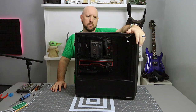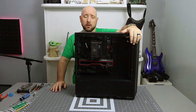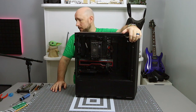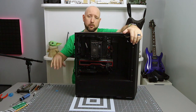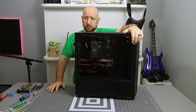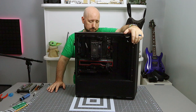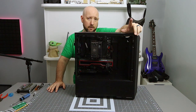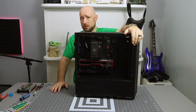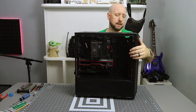The Aorus X570 Elite, man, that HDMI versus DisplayPort thing, that was a big pain in the butt. That took a long time to figure out. I did a lot of stuff, you know, pulled apart the other motherboard and CPU combinations. Flashed the BIOS a handful of times, pulled cabling all over the room, all to find out that it doesn't like HDMI. That seems like a bonkers thing for a BIOS. So for a BIOS to prefer one display connectivity over another, don't get it, but okay, seems to be working. If you're having the same problem, though, with an Aorus, probably any of the Aorus line, try switching to DisplayPort. See if it helps out. Now round back.